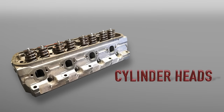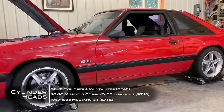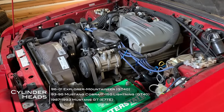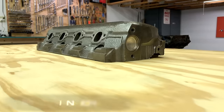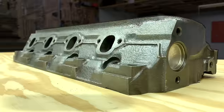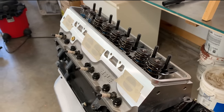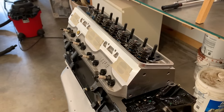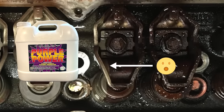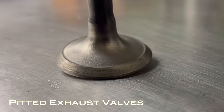When it comes to cylinder heads, if you buy a late model 5.0, most of those came with the GT40 heads, which are a really good set of cylinder heads. Late model means late nineties Explorer or F-150 truck; the late eighties and early nineties Mustangs had them too. These heads flow very well, and their performance gets pretty close to an aftermarket aluminum cylinder head if you're willing to put a little work in. I cleaned up the heads, and the exhaust valves were very pitted so they needed to be replaced — and for good measure I replaced the intake valves too.